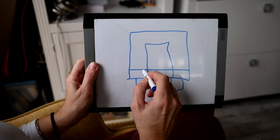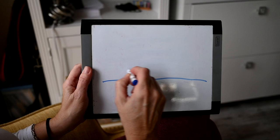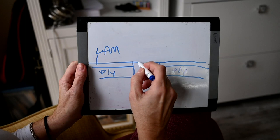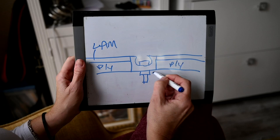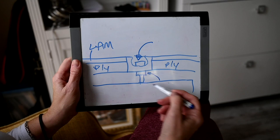So you have the base of the metal structure, and then above that you have plywood on both sides of the rail, and then you have laminate on top of that. The rail sits right in here, kind of goes down a little ways, and then there's a bolt that goes down below through the structure — the nut is below the base metal structure of the bus. Steve was down under the bus holding that while I was on top unscrewing. Sometimes you run into the gas tank or fuel tank and you can't get to those bolts.